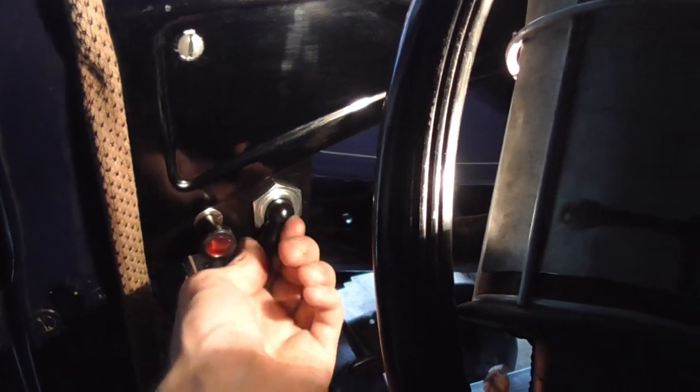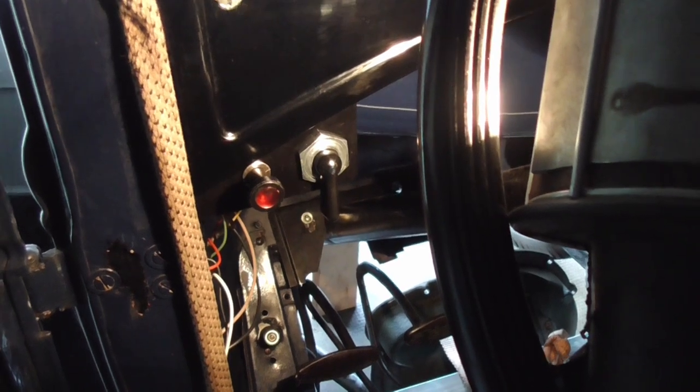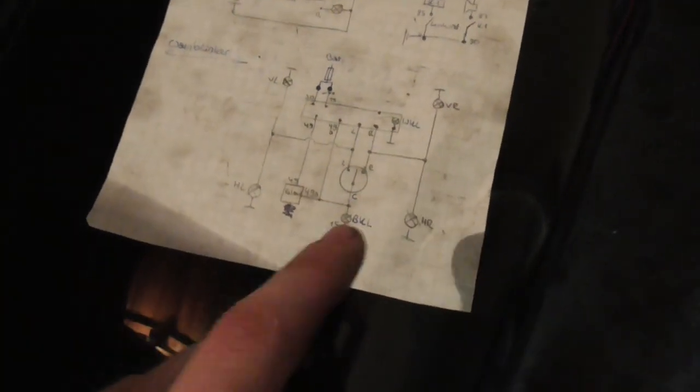Well, it's looking pretty good. And I gotta say, if it worked as good as it looks, then I'd be pretty happy right now. But it does not. There was just some erratic clicking from the relay, then some sizzling, and then it stopped. No lights ever showed up, and it seems like I cooked the relay by wiring something wrong. Found the error. Mistakenly thought the relay would need a connection to ground. It does not. And now with a fresh relay, we should just be able to...